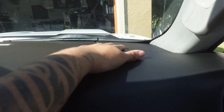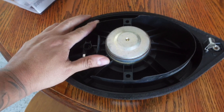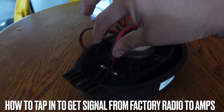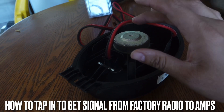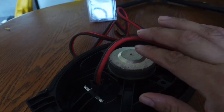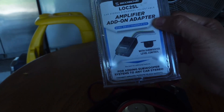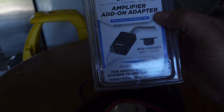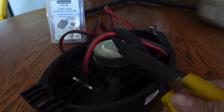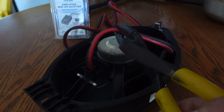The front dash speaker is the signal we're trying to get into. Basically, we'll pretend we take this speaker out — this represents our front dash speaker that we're going to get signal from. This is the speaker wire going into the speaker. Whether this speaker wire is coming from your factory radio or from your factory amp, it is still signal going to the speaker to make it play music. So this speaker is going to be your signal, and this is what you need to feed into your LOC so it can convert that speaker wire into RCA signal.